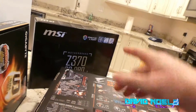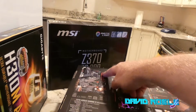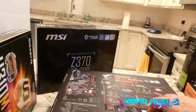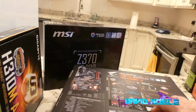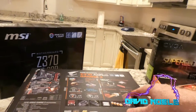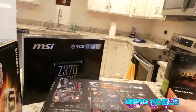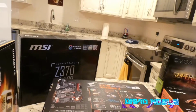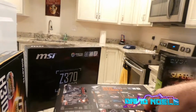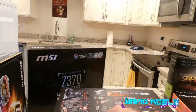This is ATX, that one's an ATX. They have a lot of really good features on them. 4 RAM slots, the ability to have dual video cards going. This supports the PCI Express x4 M.2 and has 2 of them, which is nice. So if you're able to figure out how to boot your computer from those devices, it will make it super fast. And this allows overclocking, okay?